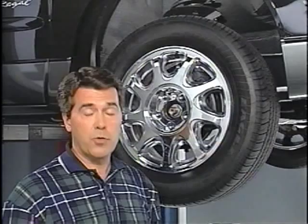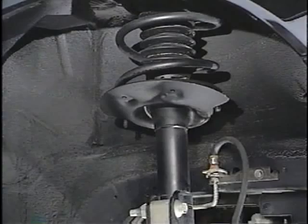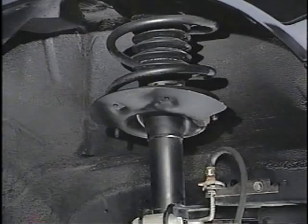Another noise that appeared on some very early production cars was a flutter that was caused by the front spring touching the metal when the spring was fully compressed, as when going over a bump. The front spring design was altered by the supplier to remedy this condition. If you encounter this condition, you should install a current production spring to eliminate the noise also.